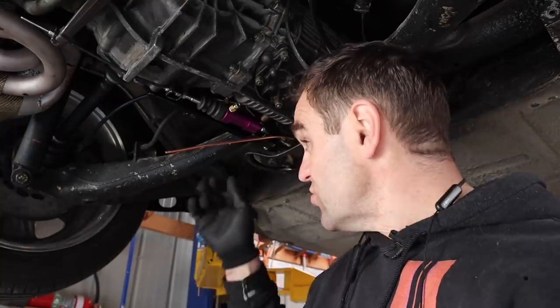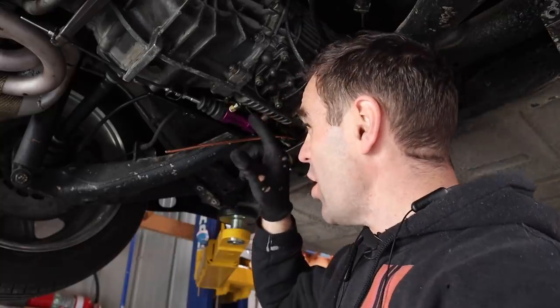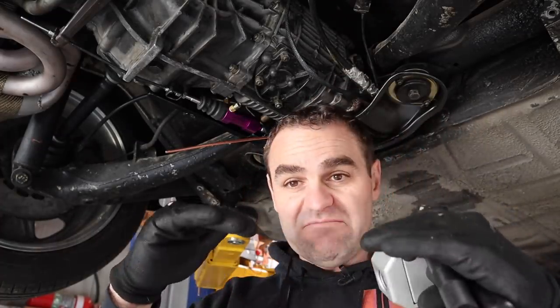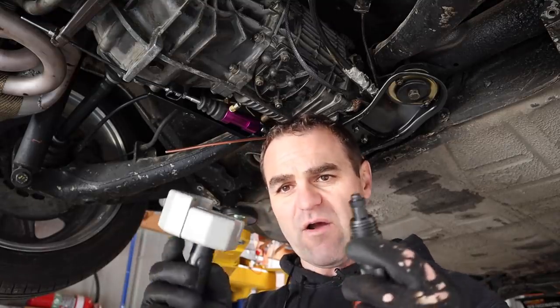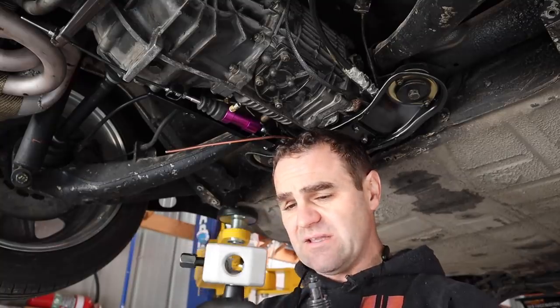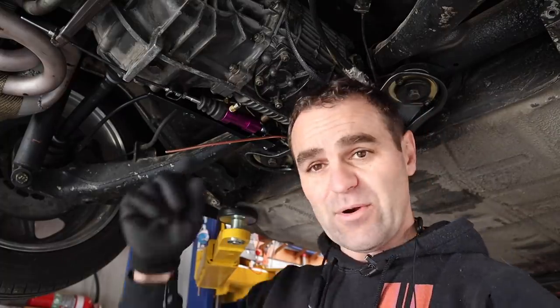I've got my brake line through and cut it to size — a nice length with a bit of room to wrap it around and make a nice transition. I double-checked that I've got the right fitting for the end of this, and I wanted to note that the inside of this is a different shape. It takes a different shape flare to what the master cylinder does at the front. The master cylinder at the front needs more of a bubble flare because it's got a tapered seat, whereas this one has an inverted seat, so I need to make a flare with a cone in it. There are a couple of different styles of flares. I've got a really good brake flaring tool kit now. I've used more basic ones in the past and they're not that great — definitely worth getting a reasonably decent tool. This one wasn't that expensive, but it's good. I might put a link to something like this in the description.